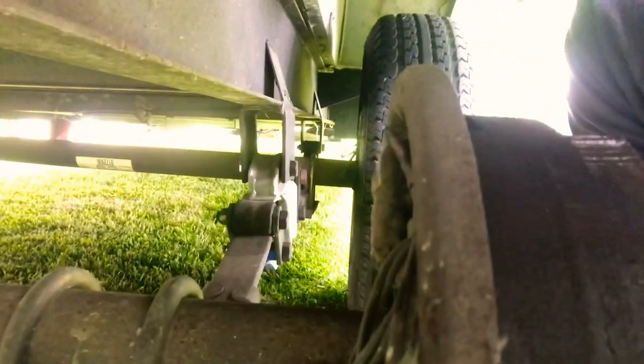The other thing we want to look for is any cracks — and just so happens there are a couple here. That means the next time I do bearings I will also be doing brake shoes. I want to say — and I have to check because I don't remember — that crack is actually acceptable because it's in the middle of the pad and that particular crack does not appear to be over two inches long, so that is technically acceptable, if I'm not mistaken. Please don't quote me on that.